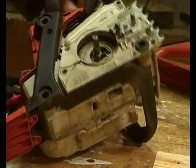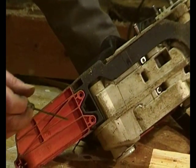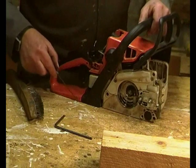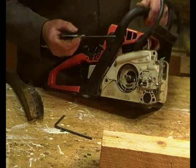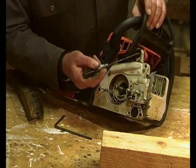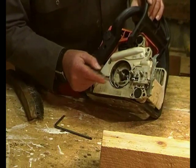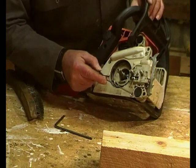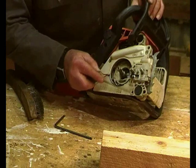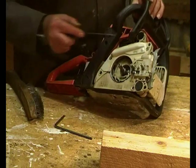And then the next thing, of course, let me just see, I've got to fit these two screws here to stabilise and fit the back handle. So that's these screws done there, and the rubber bungs in there. The rubber bung for here is a smaller diameter one, the plastic bung. And be careful of this one down here. Sometimes the rubber mounting can get pushed too far out. So when you push this plastic bung in, it's stuck out a reasonable distance. So pop the plastic bung out and push the rubber mounting back in a bit so that when it finishes it's all nice and flush.